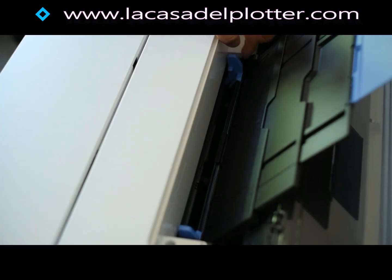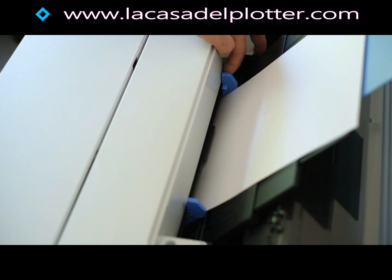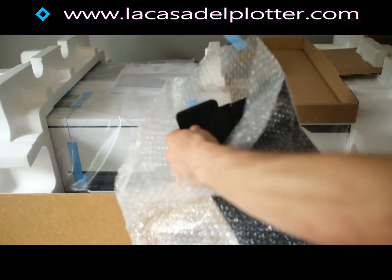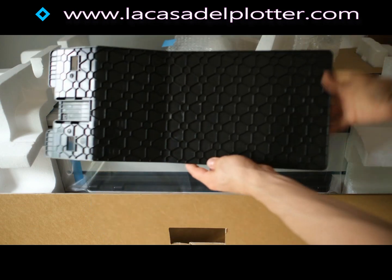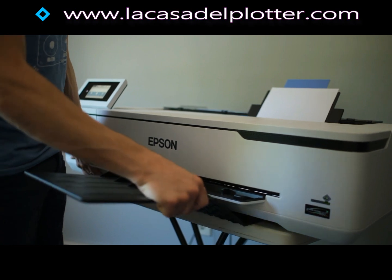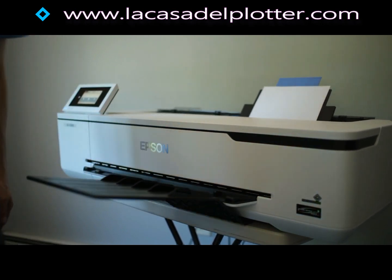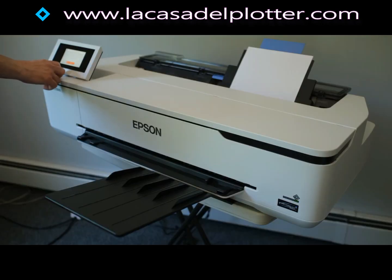There is an adjustable guide right here. Make sure it is adjusted correctly for the size of media that you're using. You don't want it to squish the paper too tightly. Then we can grab that media catch that we unboxed in the beginning. And if we want, we can place it right under the printer right about here. It should snap into grooves that are located under the printer.